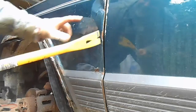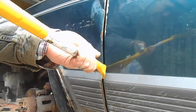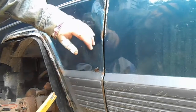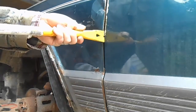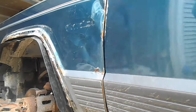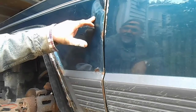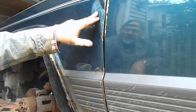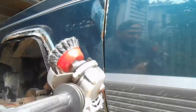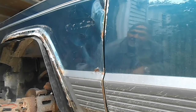After a bunch of playing around, I actually had to tear up the edge of the door there so I'll have to paint that as well. It took a while because every time I opened the door I'd get the dent out, but then the door would catch along here and push it back in. So I had to get the pry bar in here and wedge a bunch of it forward. It opens and closes now, but there are a couple of high spots and some really low spots — that's going to take a ton of filler, which I really didn't want. I'm going to take a wire wheel and grinder and get all this paint and rust off and see what it looks like.